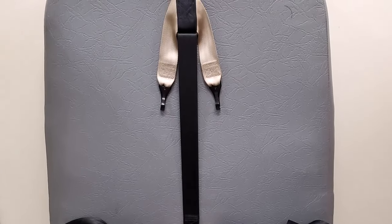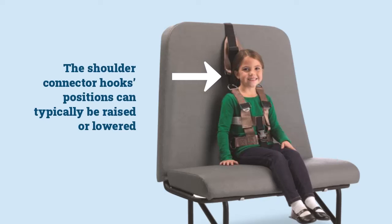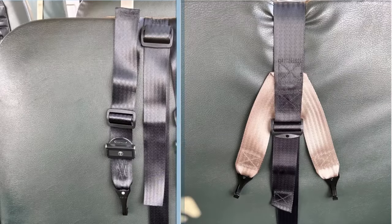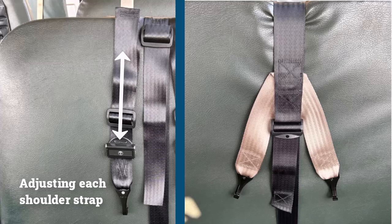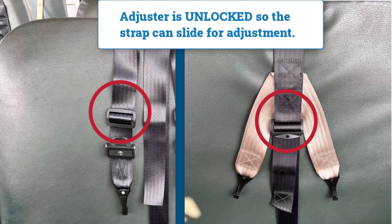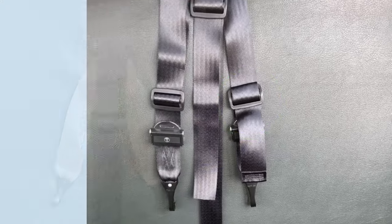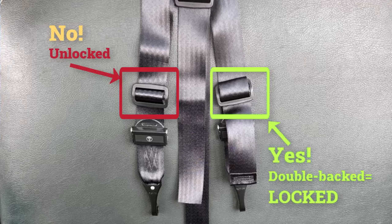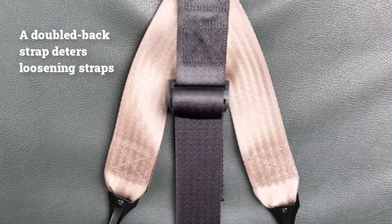Be careful to remove all slack without pulling so hard as to pull the vest upward. Always check that the seat mount shoulder adjusting mechanisms are locked. So that the upper attachment points of a safety vest seat mount align properly with the seated child's shoulders, the shoulder connector hook positions can typically be raised or lowered. The methods used to do this include lengthening or shortening the central cam wrap strap, or sometimes by adjusting each shoulder strap. After making these adjustments, ensure that the straps are locked at a fixed length. Most systems feature an O-ring adjuster that must be doubled back after the system is fitted to the child.